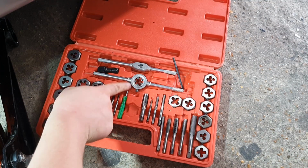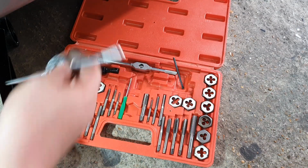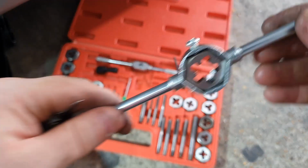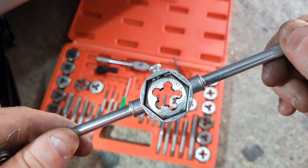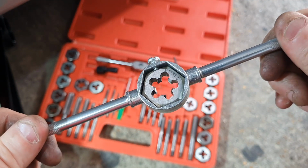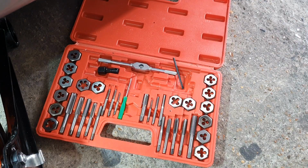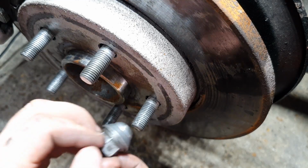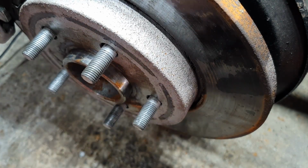I've already got an M12 1.5 pitch in here. I'm obviously mucking about with them before. Luckily that was the one I need. See, M12 because it's the biggest bolt, and a 1.5 pitch. You get various selections. I'll put a link to this in the description. So as you see, that was tight going on there because the first few threads are damaged.